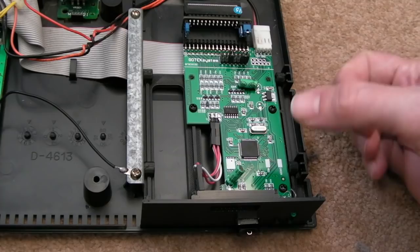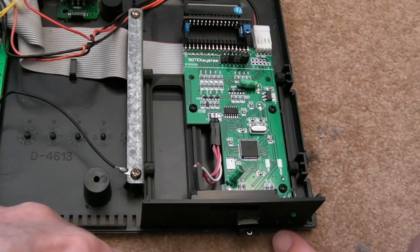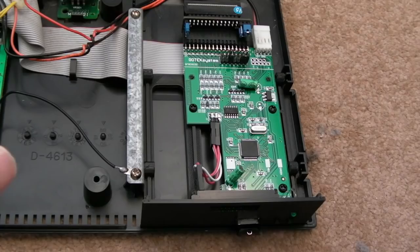Because I'll show you, I'll recreate it. What happens is when you go into the menu without the USB in there, if you've not got this jumper on, it thinks that switch has been pressed. So when the menu comes up, the first option is reset for the firmware settings. It's not the firmware, it's actually the settings it uses to configure the thing. It resets those, and it did that automatically. So when it happened, I was like, oh my god, is this going to cause me another problem now? No, it's accidentally reset. I didn't even choose that.